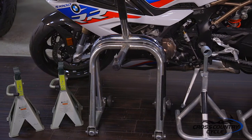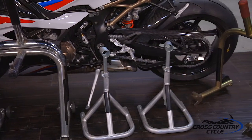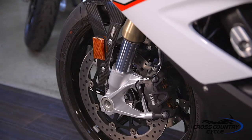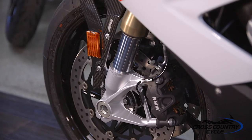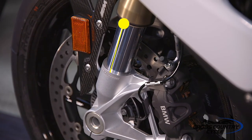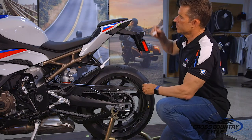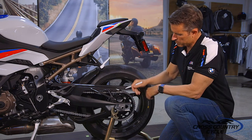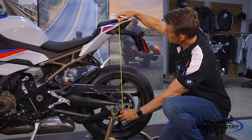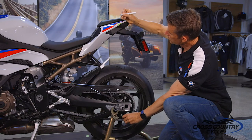We can then lift the motorcycle using an engine jack or stand so that the bike is completely off the ground. We will be using a lower triple tree stand for the front and a pillion stand for the rear. In preparation for our measurements, we will identify exactly where the measurements will be made. For the front suspension, our starting measurement will be at the edge of the dust seal, ending at the edge of the fork tube and front axle. Moving to the rear shock, we measure the distance from a vertical point on the cowling to the axle, using a tape measure as a pendulum to obtain a vertical line, then marking that point with tape and a pen.